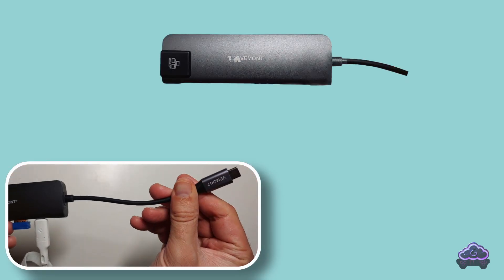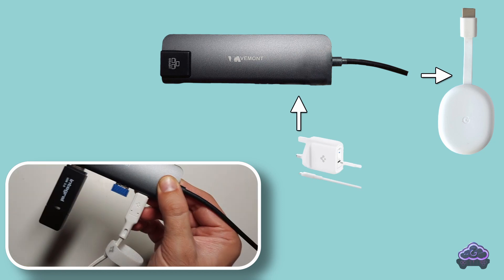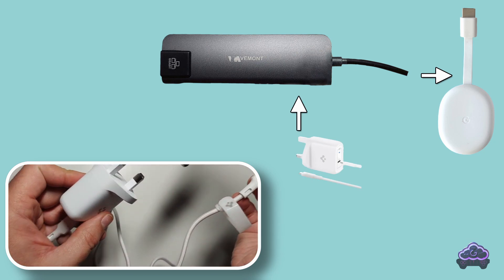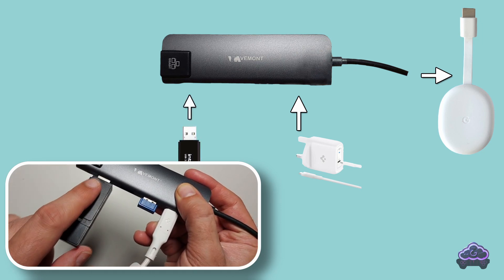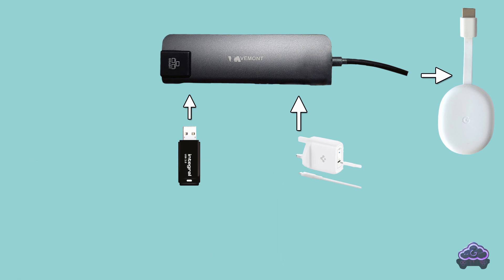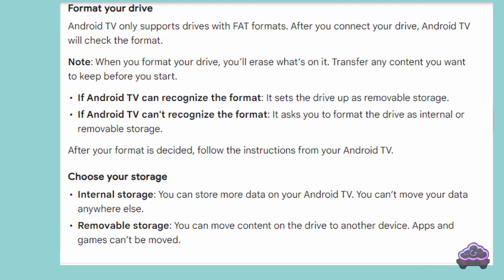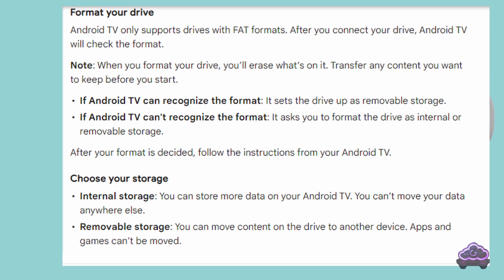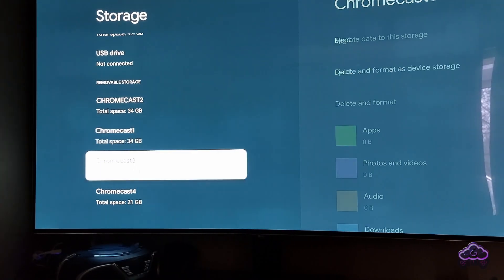Let's see how we connect everything. The main USB-C cable included goes into the Google Chromecast, and then you plug the power adapter into the Type-C charging port. If you then want to have some more storage, you need to connect a new drive into one of the USB ports. The Chromecast will then ask you if you want to format this drive as permanent storage or as external storage. What you choose is up to you, but I would recommend external — it makes it easier to transfer files since you will still be able to plug it into your PC.